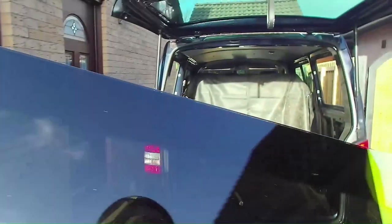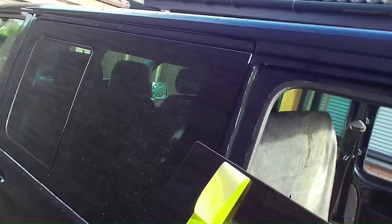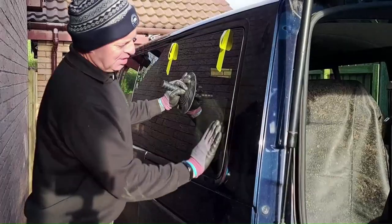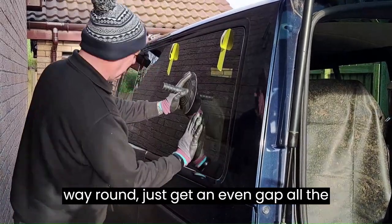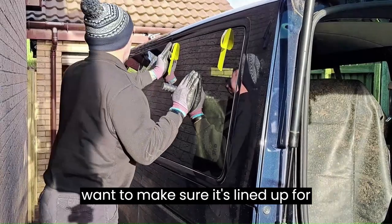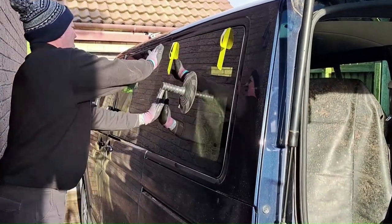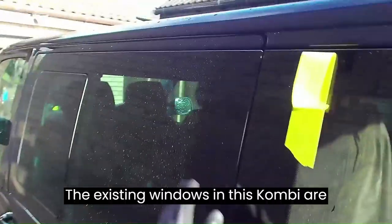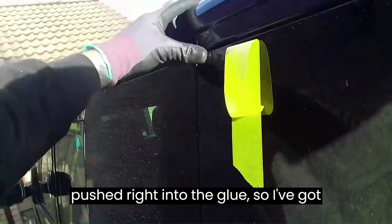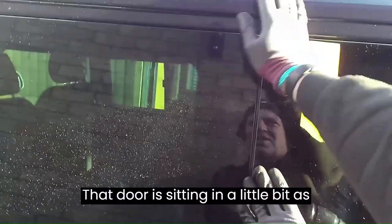Just pick the correct window — it's just a case of guiding it up. Leave a 2mm or 3mm gap all the way around to get an even gap around the bodywork, and make sure it's lined up in height with the window in front of it. I've got to really push this one in to get it level and flush, as the existing windows in this Kombi are pushed right into the glue, so I've got to push mine in just as far to make sure it's level.